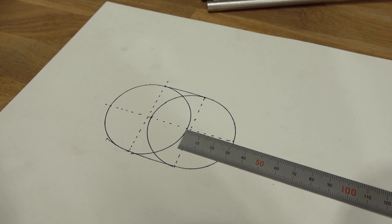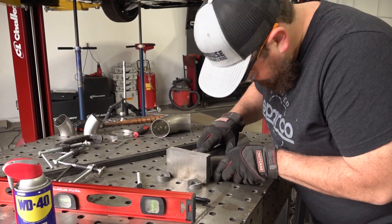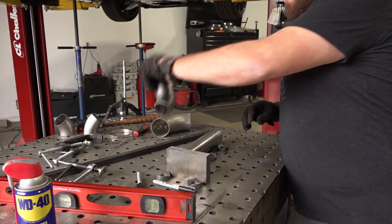With the center tube notched, I've drawn out the cross section of the oval tubing the resonators will be merging to. Having this drawn out helps me make sure I don't cut off too much material, which would pull the tubing away from the fixed position of the resonators.